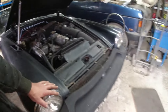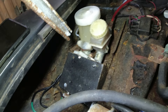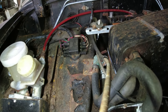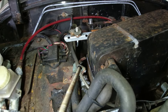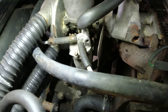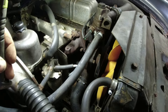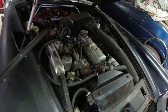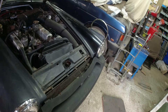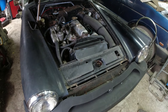It's possible that a good length of time in warmer climes with less salt on the road has meant this thing is actually not in bad shape. Under here we can see there's lots of surface corrosion and peeling paint, original wiring loom with signs of heat damage from its extreme climate. There's a nice little original BL cast badge in there. Overall it is pretty good. Perhaps the smallest radiator I've ever seen - the cooling system runs hot and I suspect the radiator matrix has never been changed. This is a 1979 car, so you can do the maths.